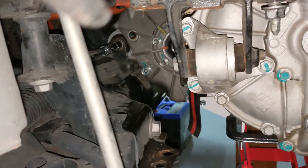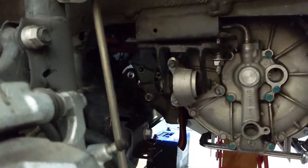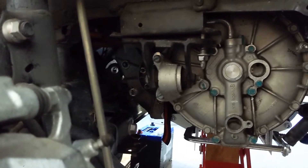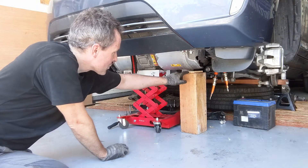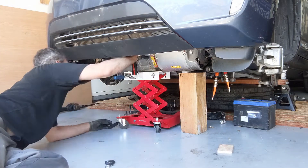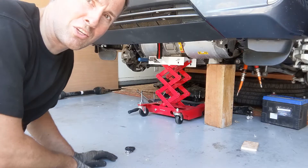The three bolts are loose. Now there's a bolt all the way at the end — that's the last bolt holding the motor in place. You need a lot of extensions, a breaker bar, and a lot of torque to get it loose. Now the motor is completely loose — good moment to check if there are no wiring harnesses or cooling hoses left attached to the motor before we lower it. I forgot we also have to remove this bolt over here, so we're going to do that now. Alright, attempt number two.